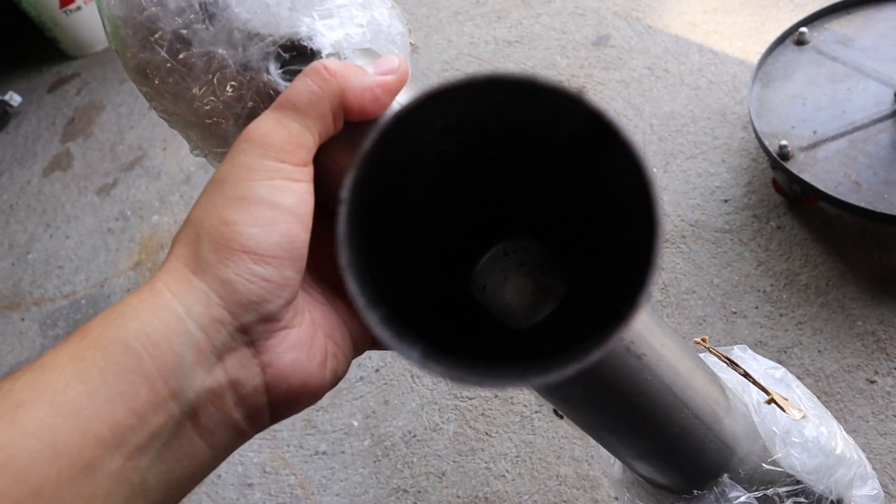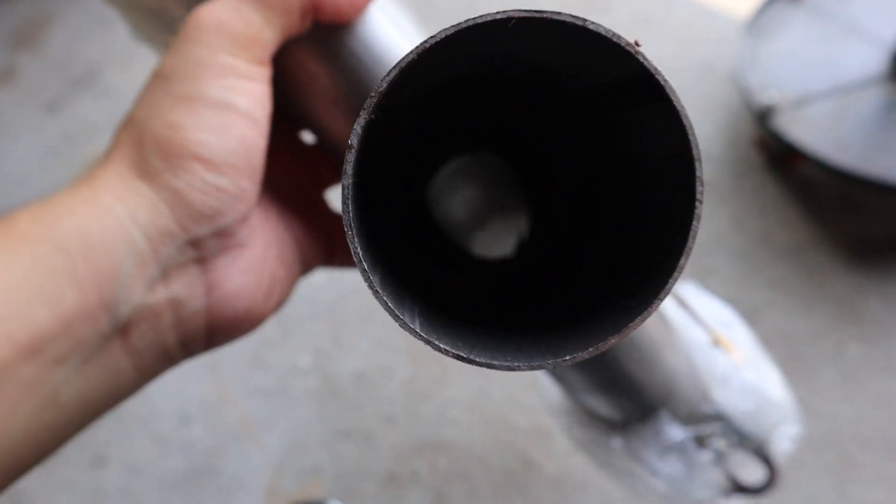So check this out — here's why I say it's like a hybrid. I don't know if you guys can really see within this general area, but if you look really in there, you should actually see that the hole for this particular system, it's not that big. Compared to your usual X-Pipe, that's mainly because this is really an actual hybrid sort of system. It gets the flow going through the X, but it'll have the same relatively nice noise like an H-Pipe, which is the grunt noise. And I personally do like that grunt noise, so that's why I really picked these particular X-Pipes.